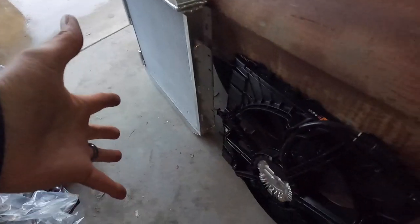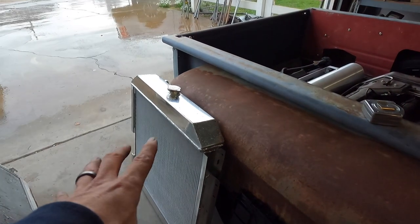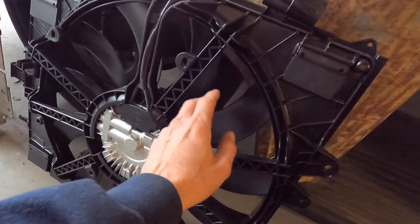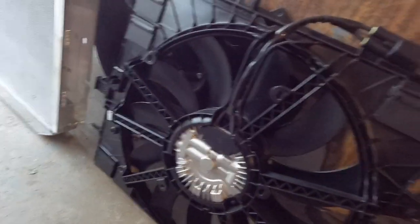Also the airflow — that's where the fans come into play. When you're just cruising down the road, the radiator surface area is going to take care of you if it's properly sized. When you're sitting still, this fan setup is really what you're going to lean on, whether it's mechanical or brushless.